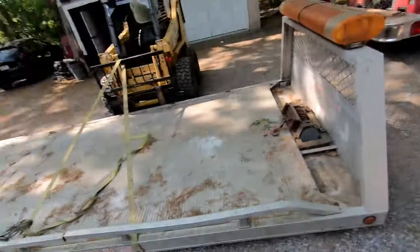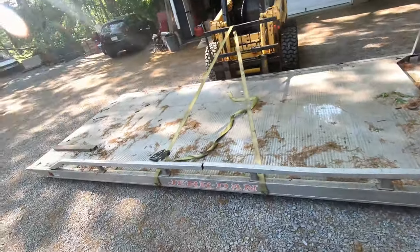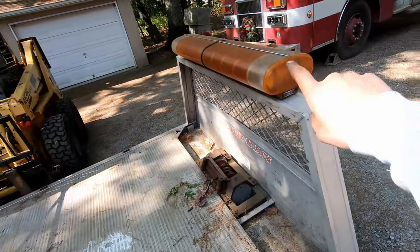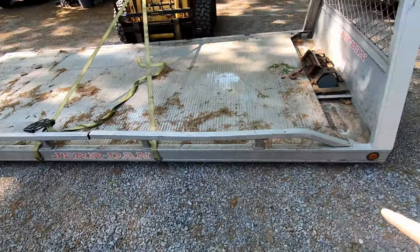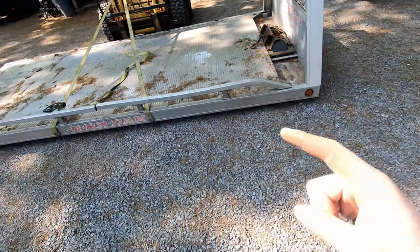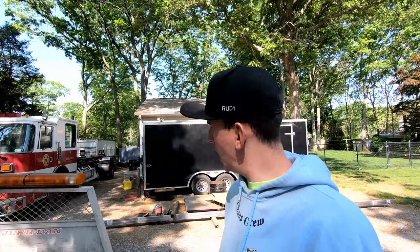It's a new day out here in Gallery Garage. What I have planned today is working on the bed itself. I got to take the light bar off right away, then flip it over because it needs some repairs on the bottom - a couple of the welds are cracked. Also, on the old bed one of the brackets was broken and gouged one of the rails, so I'm going to fill that in, grind it down, and fix that up.